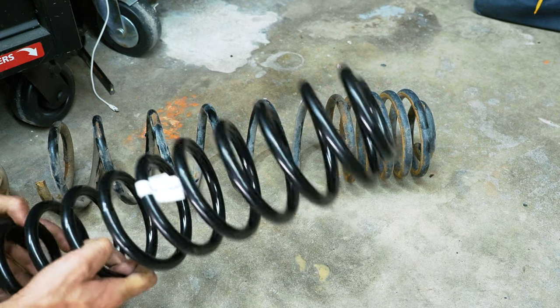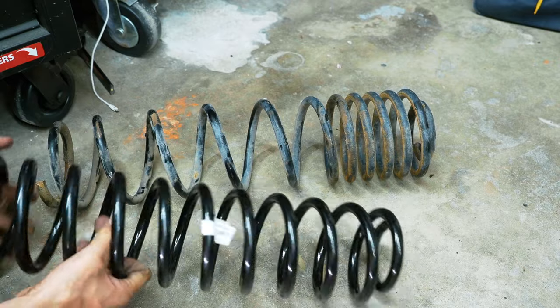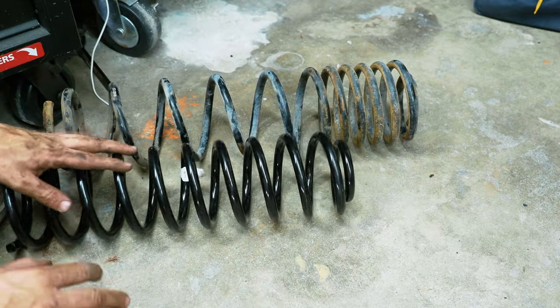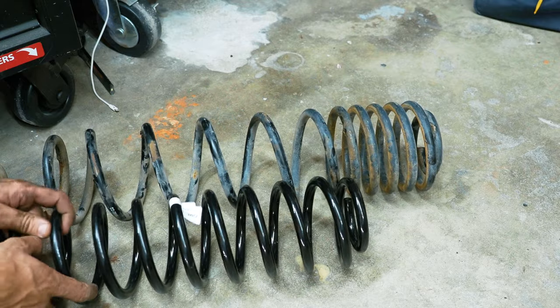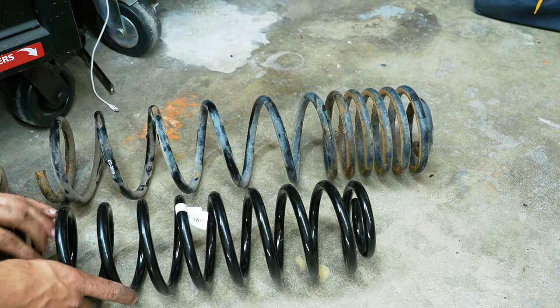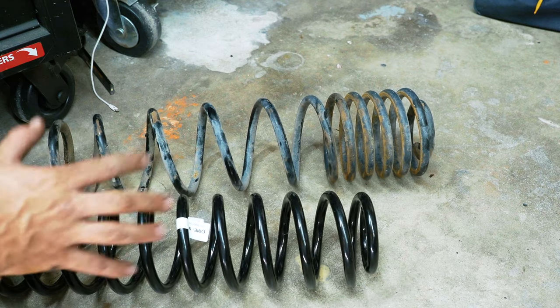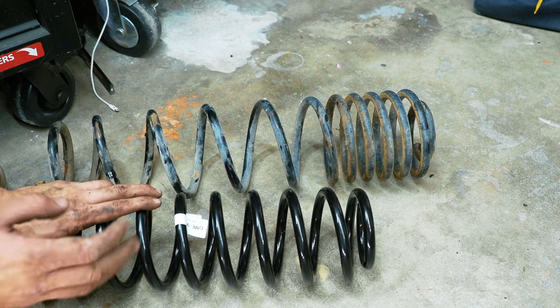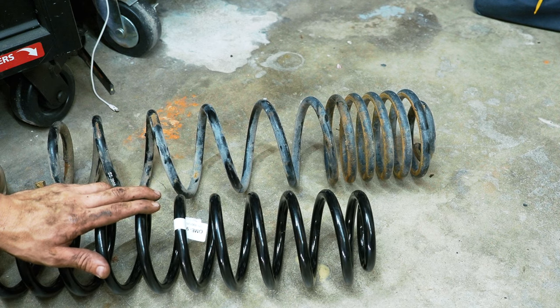There are two different ones. That's what's cool about Old Man Emu. Your vehicle, specifically a TJ, one side is a little bit heavier than the other, so they give you one spring a little heavier than the other or a little longer than the other. And that's to help compensate and balance out any irregulars from side to side, which is pretty cool. So I'll figure out which one it is, and we'll wait for the paint to dry,